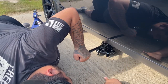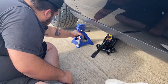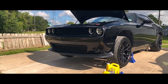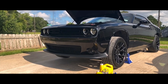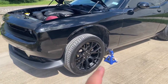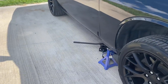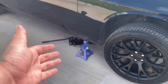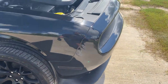Use a jack to lift the front of your vehicle from the appropriate jacking points. Always remember to support the vehicle on adequate jack stands. Now we have the car jacked up — we have one jack stand on this side and another on the other side. What I like to do is also lock the floor jack in place, just in case one of the jack stands fails. That way the car won't fall on you — you have that third support.